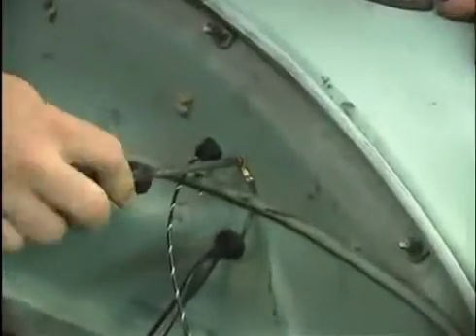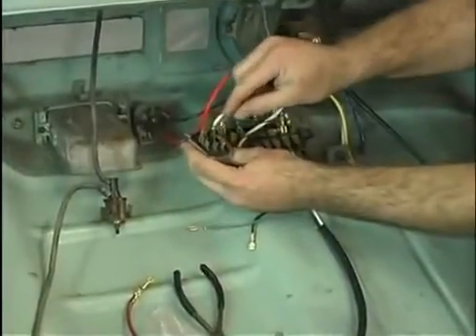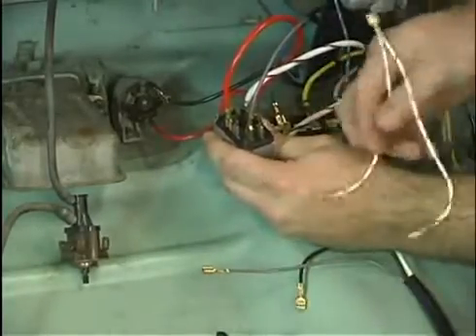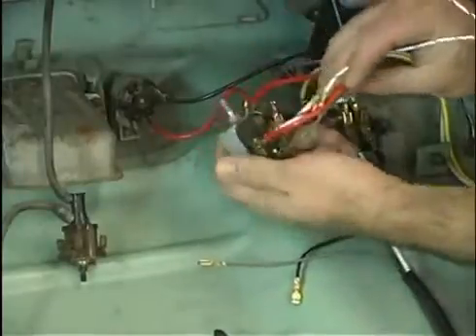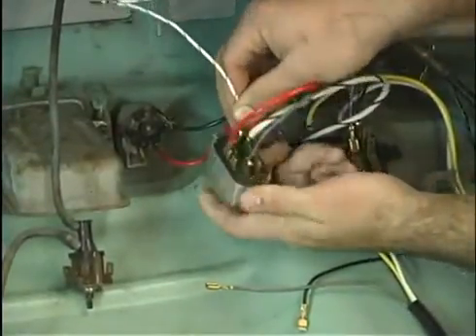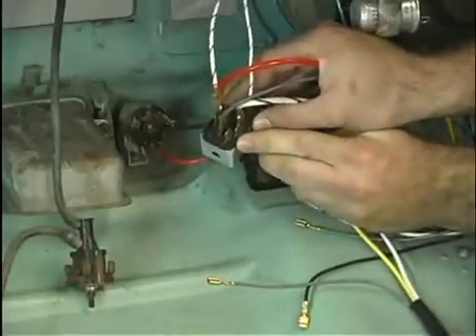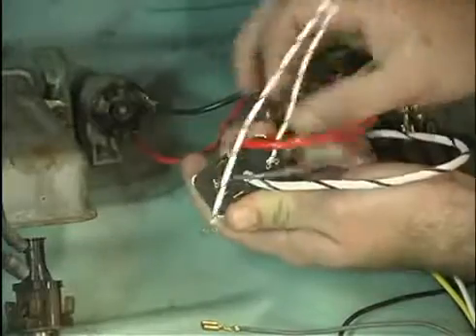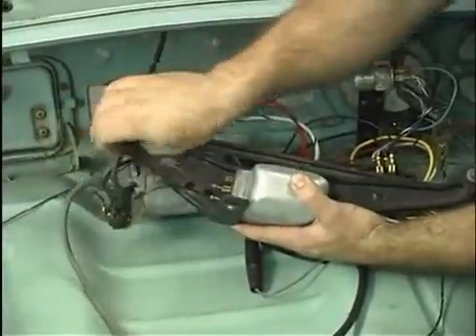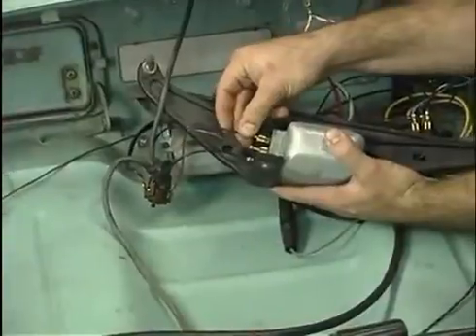Sometimes if this is loose you'll end up with a dim headlight. This gray wire attaches to the 58 terminal, and we also have this white wire with a red tracer that attaches back here on the 58B terminal — this is our instrument lights. Now originally our parking lights were hooked up to these 57 terminals down here, so they would come on with the first click of the switch with the tail lights, and then with the second click they would go out while the tail lights and headlights stayed on. The next one is our black wire with a red tracer on our 54D terminal.